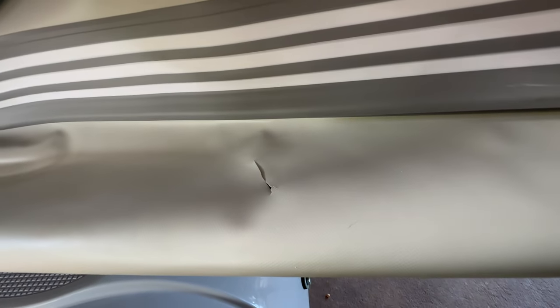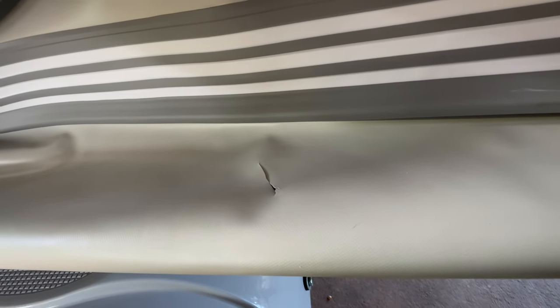It's going to be a slow process. Clean the surface with acetone, let it sit, clean the surface again, wait 10 minutes, then start applying the glue. Let the glue sit, reapply another layer, let it sit, and then while it's still tacky you apply the patch. Put a lot of pressure and roll it to make sure there are no bubbles.